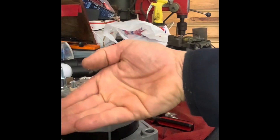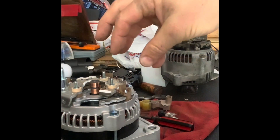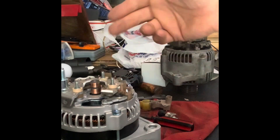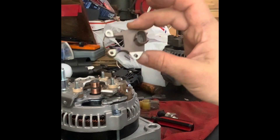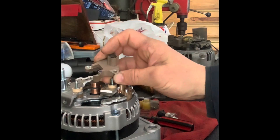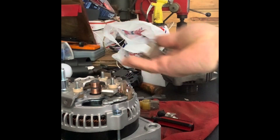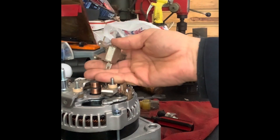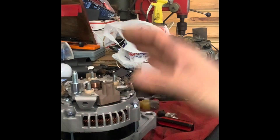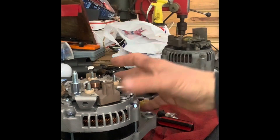There are many replacement regulators depending on what voltage you want. There's a GM style that goes straight in with a straight four-pin connector. There's also a Lexus/Toyota style with a square pin. Dodge has their own. You can get rid of the pulse-width-modulated regulator and replace it with an internally regulated one. The GM part number for 14.4 volts is 12582024.